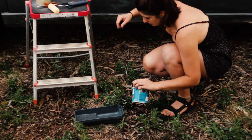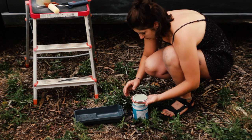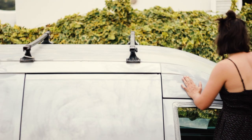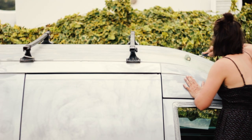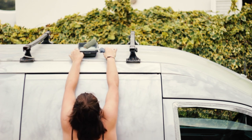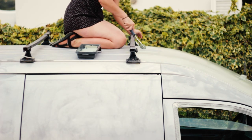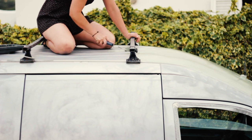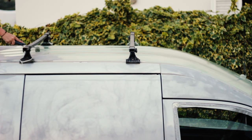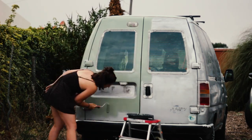Finally I started to paint using a greenish gray acrylic lacquer and a short hair roller. At first I wasn't too sure about painting a car with a roller but after watching some YouTube videos I thought it would be the best option, and the truth is that it gives a super smooth and uniform finish. I started by painting the roof and then all the sides and I was immediately pleasantly surprised with the result of the first coat.